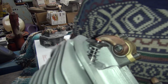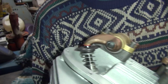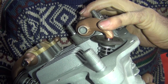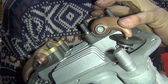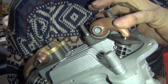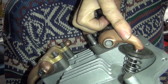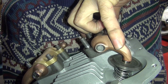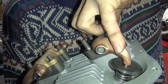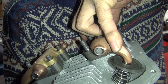So the last valve is the worst one, obviously, but you can see how it sweeps real bad across, but it's better than it was, I guess. So it goes across, and at the very tip there it goes off, but that's way more lift than we got. That'd be only like 600 thou lift, so in the real world we're only going about to here. Right about there is about where we max out. That's 600 plus. That's probably 500 right there. We're about in this area.